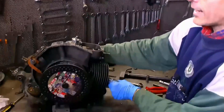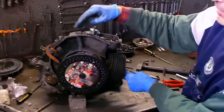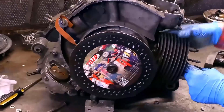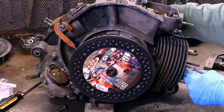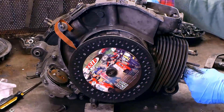So we move to the 125. In this case we have taken two crankcases, one almost complete and the other not, but from the same era — PX with electric starter. We used as a cylinder the evergreen Polini 177, which was a bit worked. We mounted it on the engine that has the shaft at stroke 60 with connecting rod 105.